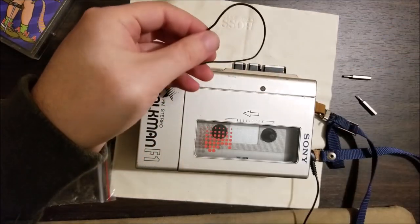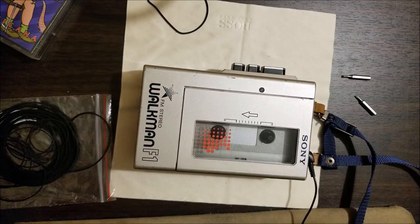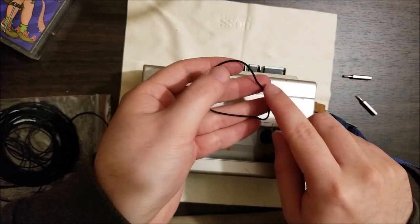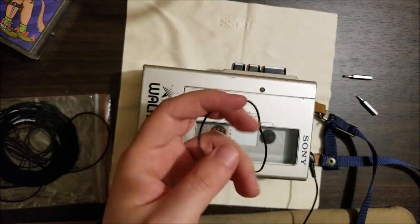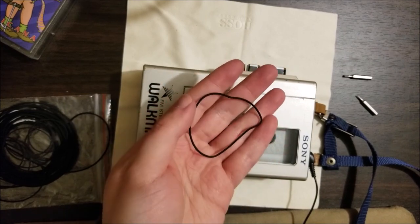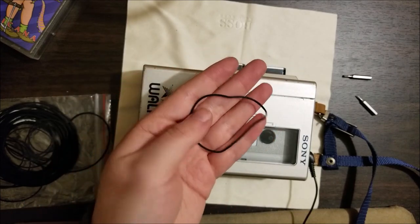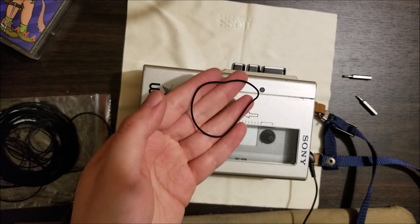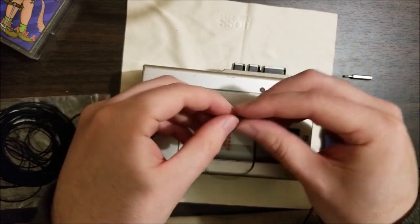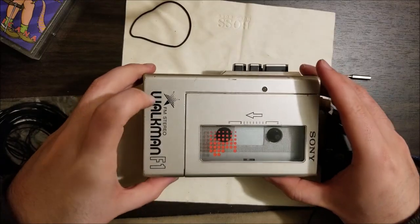All it really needed was a new belt. The other belt that drove this little spindle here was nice and tight, so that was good — it was just the main drive belt starting to get a little crusty and the shape was deformed. Now, one thing I eventually want to try: apparently you can rejuvenate these belts. I was watching another YouTuber — I believe his channel name is 12VoltVids — and he said an old trick is to put the belt in a glass of water and microwave it for a short while, and it actually makes the rubber soft and pliable again. So I'm going to have to give that a try. But anyway, for now this unit is good to go.